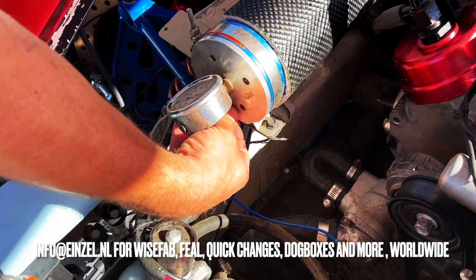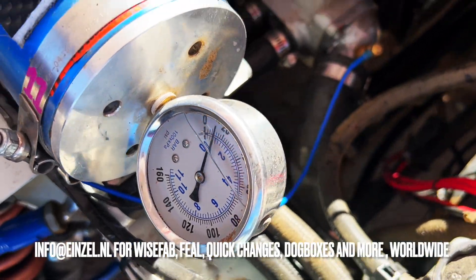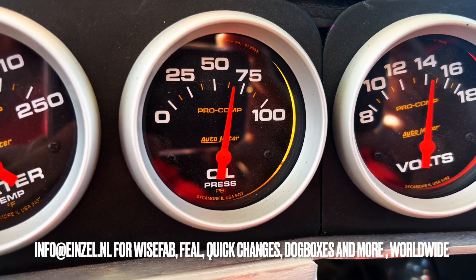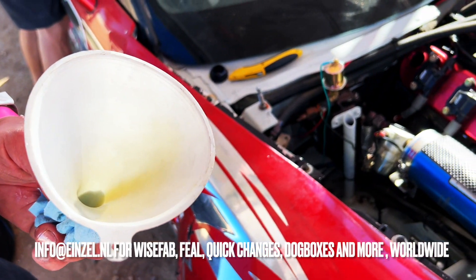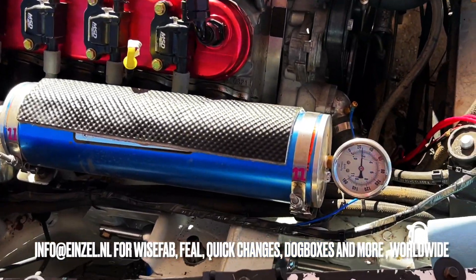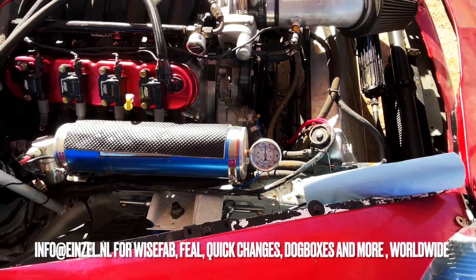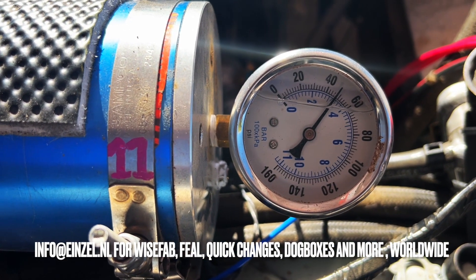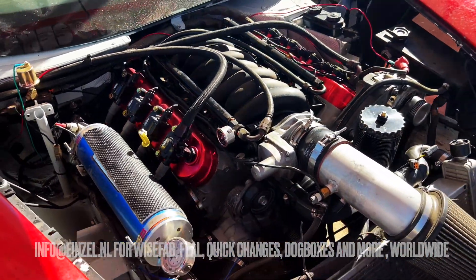After you close off the Schrader valve with a cap, you start up the motor and let it get to operating temperature. You can see the oil pressure climbing — the AccuSump is not filled yet, so by running the motor you're filling up the AccuSump, which gets back pressure from the preset load. This will take some oil out of your pan, so you have to add a little bit of oil after — usually a quart and a half or two quarts. Now you can see it's running perfectly and you're ready to use the AccuSump.